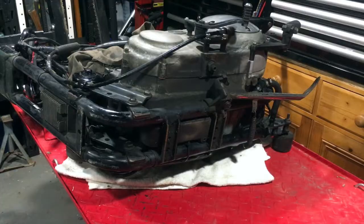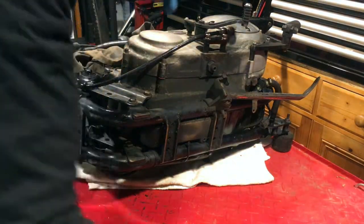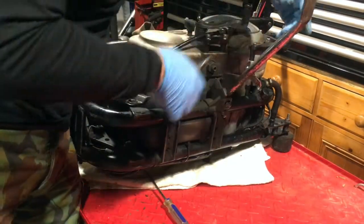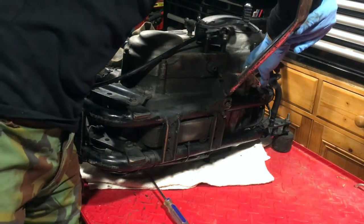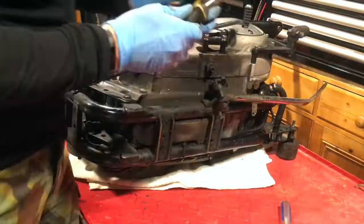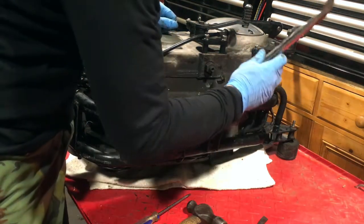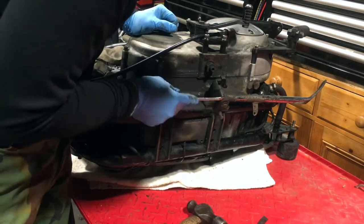What I really need to do now is to remove the side stand. That's a bit more secure, and now I can remove the spring quite easily and we can get at the pin to remove the side stand. The engine is going to leak a bit of oil but that's not really a big deal because it's only the residue from draining the engine. Getting the cotter pin out is the relatively easy part — I'm not really sure I'm going to be able to get this pin out because I think it's going to require leverage. Seems pretty stuck in there.